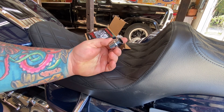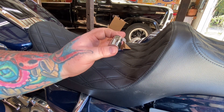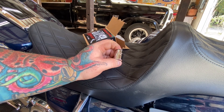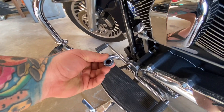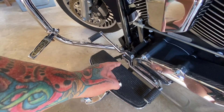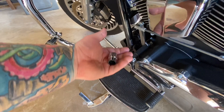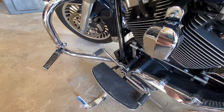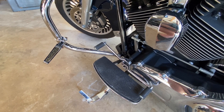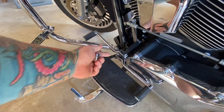Overall you're spending maybe $10-15 more and getting a much better quality part. I've learned to just buy the good stuff instead of doing it twice later. You're working with your shifter here, so you don't want this falling off or anything going haywire and leaving you on the side of the road over $10-15. So you pull the heel shifter off, bring your regular foot shifter out further, and this goes right behind it to make up the slack. If you don't put this in there you'll have a lot of slop in your shifters and could potentially mess something up or even have a safety issue.